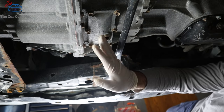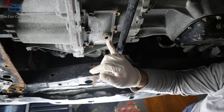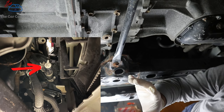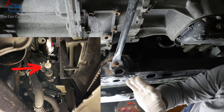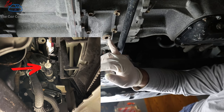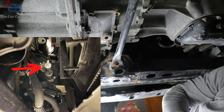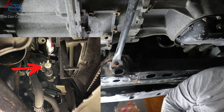We're underneath the transmission — the engine is on the other side. One style of drain for the inverter will be on the transmission directly; there's a 10 millimeter hex right here — that is your drain. Another style is a separate drain on a hose. Some models, namely the Highlanders, will also have the transmission drain but when you take it out nothing comes out, so look between the radiator and the transmission and you'll see a hose with a drain. The Prius C and some newer ones will have that style; older ones will have the drain on the transmission. You're going to need a 10 millimeter hex.